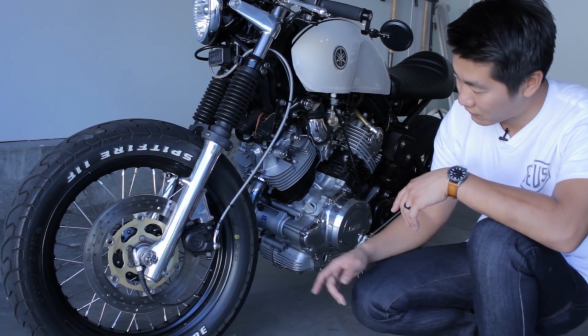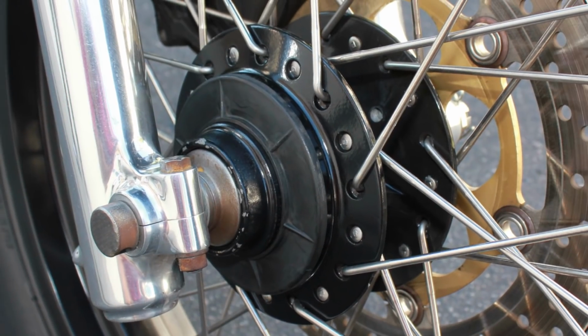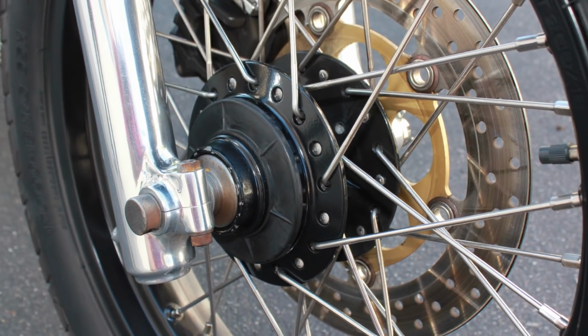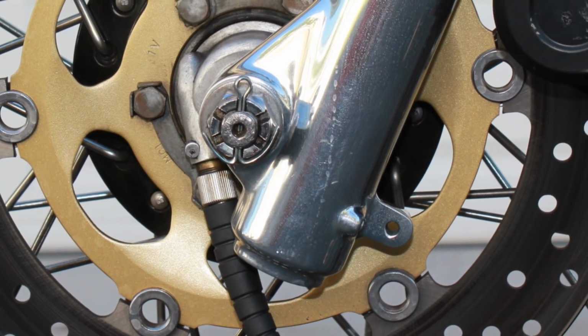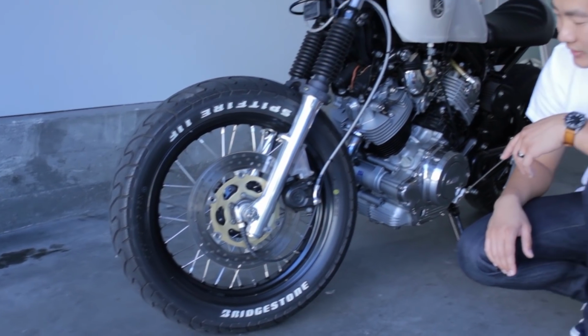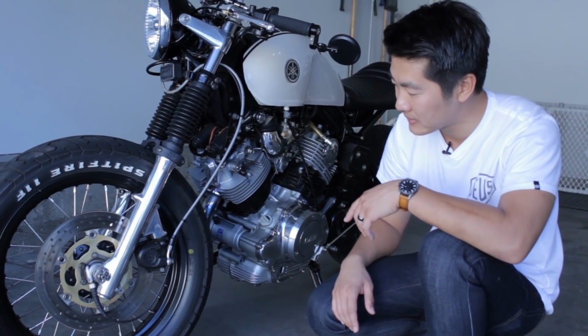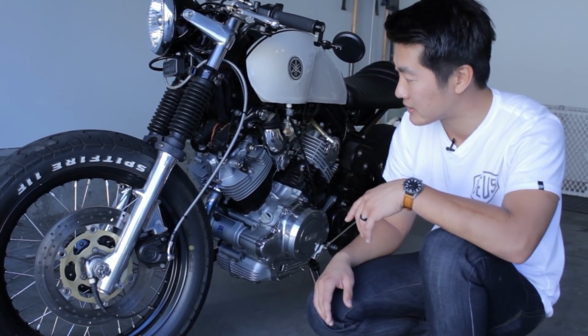With the front hub, I had to use a Yamaha XS650 front speedo drive so that I could attach it to my Acewell speedo. Everything is, for the most part, electronic, but it looks the part, and the spacing happened to be correct.